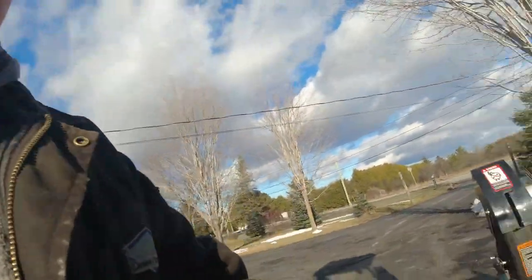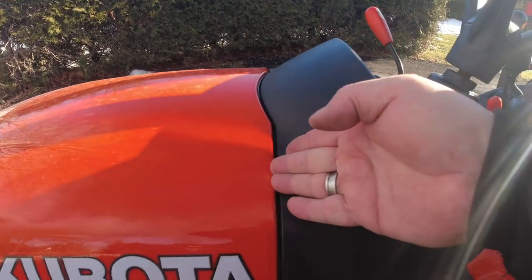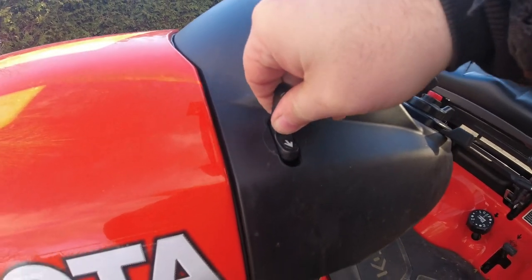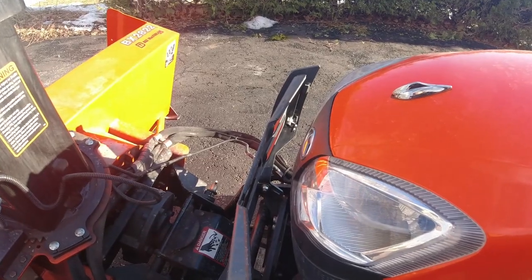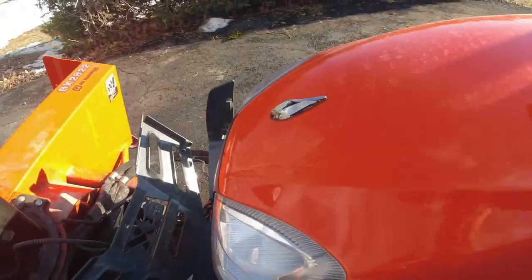The next is the air cleaner element. We have to open the hood. The latch is a bit strange — it shows an arrow to pull, but you actually have to lift up. So if you're having trouble, kind of lift it up a bit and then pull forward — it's a two-action method. Pulling straight out won't work and pulling straight up won't work; you have to pull on an angle. On the 2020 BX, also make sure you push your front grill forward. My dealer put rubber edges on it so it doesn't scrape the headlights if you forget.